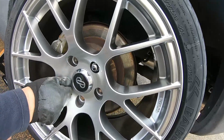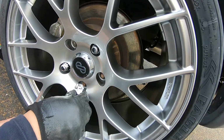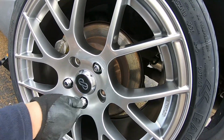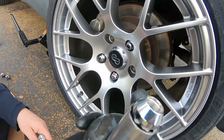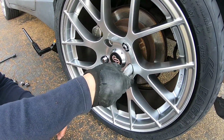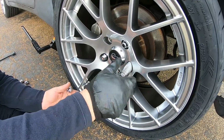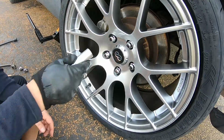The best thing to do is to finger tighten them. Then you can use the, well, actually I can do this, okay, so that's fine. If you can't use your fingers, this is how you do it. Also finger tight. If you get any resistance, it means you're cross-threading them. So just back off, and usually it will snap into place. Whatever you do, do not force them. See? Once you get them started, you're good.